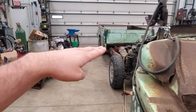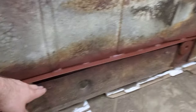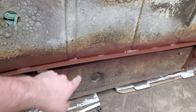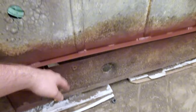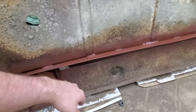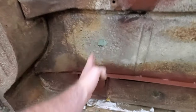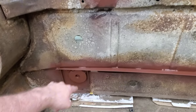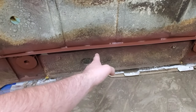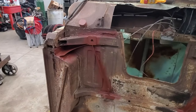So I have to put these spacer plates on there to raise the cab up to match the body line with the box. I had another reinforcement plate back here, and then welded some washers on to move the cab up. I put this flat steel here to help reinforce it back here because my seat — I've used these expedition seats. The seat bar will run here and here instead of the old-time bench seat where they're mounted way over there. I thought this gives a little more strength in that floor. How much more? I don't know, it does something.